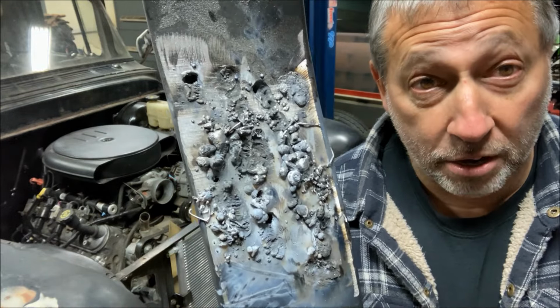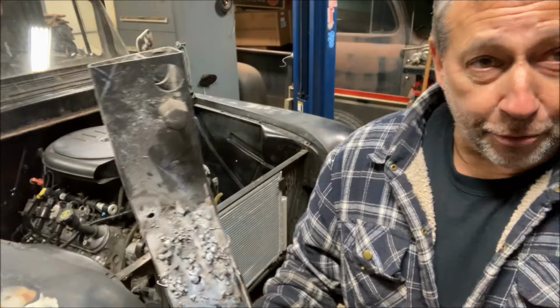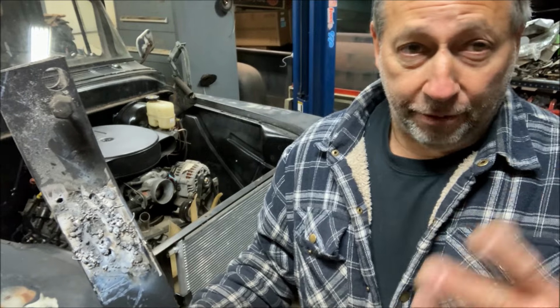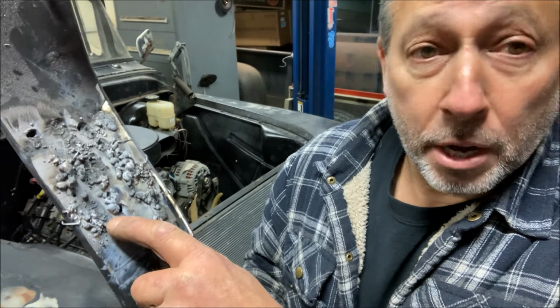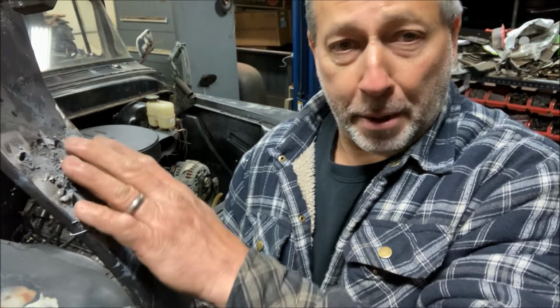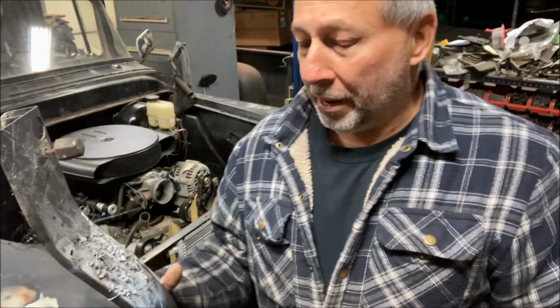That is ugly. Well, first thing I checked was the polarity was wrong on the machine. It should be just like regular MIG. The ground should be the negative and the electrode should be the positive. They had them flipped. As soon as I flipped that around, wow, now we're in business. You can't see it because it's so bad, but it started burning tracks, you know, actually welding and not just spitting and making pops.